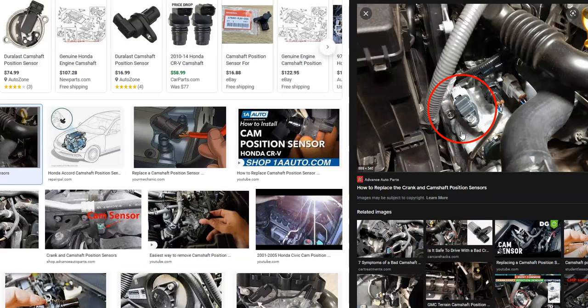So what do you do if you have a Honda with the P0366 code? First, Google where the sensor is located on your engine and year of Honda — be aware there could be two sensors. Check the wiring and make sure it's good. Check for a blown fuse. If all that looks good, replace the sensor and you should be good to go.